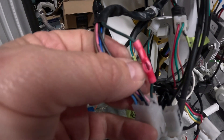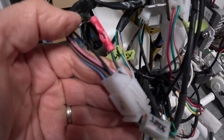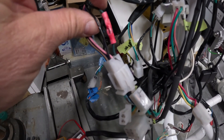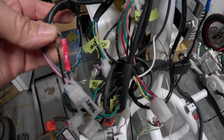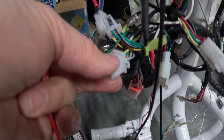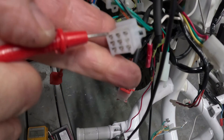Here's that plug for that switch as it goes into the main wiring harness. If you look at your yellow feed, it comes in here and turns into this green wire right here — that's going to be your AC power. Then here comes the solid black wire right next to it, and that's going to be your keyed-on DC power. So we're going to connect these two wires — the green one and the black one — and when we do, we're going to energize all these yellow wires with 12-volt DC positive. I'm just going to use one of these connectors and jump it across.